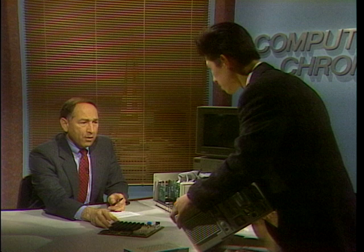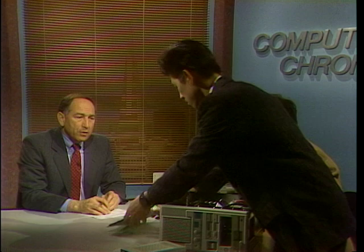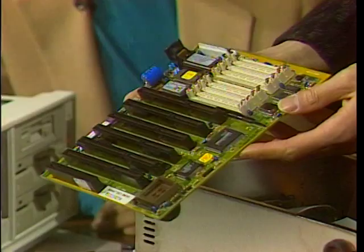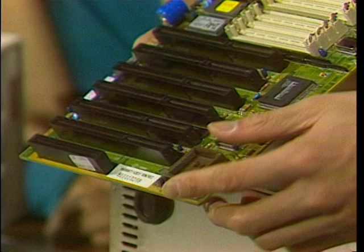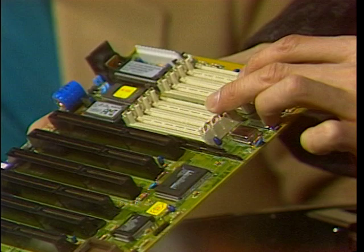Let's get back inside the box. I have here an internal power supply and a VGA card. This is the IDE controller, which controls floppy drive, hard drives, and I/O input-output devices. Is this an example of the motherboard you have inside? That's the exact motherboard. Walk us through it. This is a 386SX25, made by Advanced Micro Devices. The CPU is right here. This is a mathematical processor socket. This is the chipset. The memory modules go in here — it takes SIM modules. These are the BIOS. It's got a 16-bit bus and an 8-bit slot.